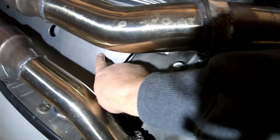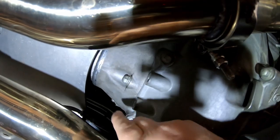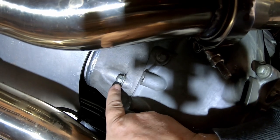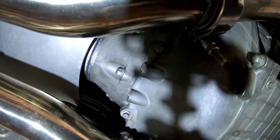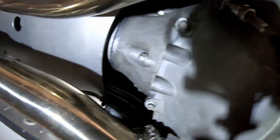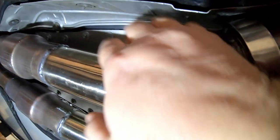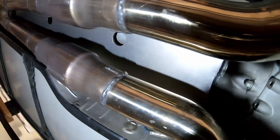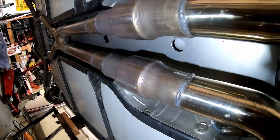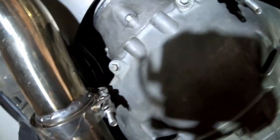The tunnel plate's put back up, of course. The torque tube, the five main attach bolts from the torque tube into the bell housing, those are torqued to 37 foot-pounds. The 40 or however many it is, little tiny 5mm headed bolts for the tunnel plate, those are all put back in and torqued to 89 inch-pounds precisely. I'm being sarcastic, of course.